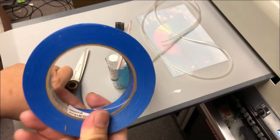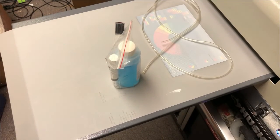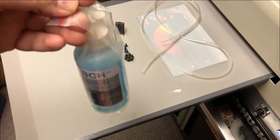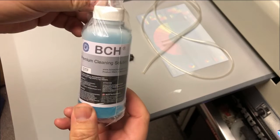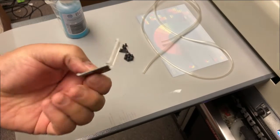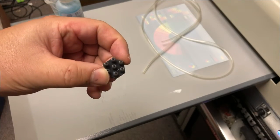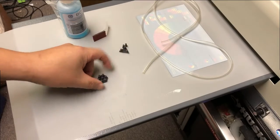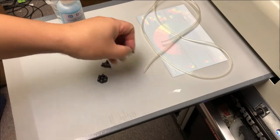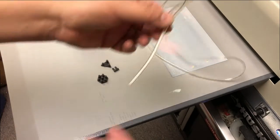I think it's less stressful for the printhead. So you'll need some kind of tape, scissors. We have a bottle of cleaning solution for DTF — you can see it already has the syringes and the tubes to flush to the printhead. I'll put a list of the parts in the description. Today we're going to use a one-to-six manifold, and if you only want to clean the white, you can use that triangle one-to-two. We also need a one-to-one manifold.